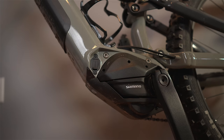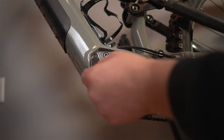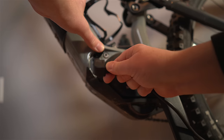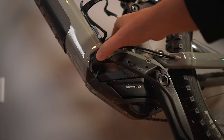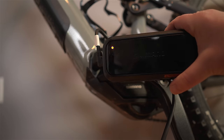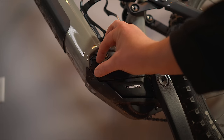For charging, you just plug the power brick into the wall and then plug the other end into the bike. There's a nice rubber port cover — always make sure that's on securely, especially if you're riding in the wet. The first time I plugged it in it took a lot of effort — I thought something was wrong, so just know you really do have to force it in, it's a really tight fit. The more you use it, it gets a little bit easier. That light will go out when it's fully charged, and it's also pretty hard to pull out when unplugging — just wiggle it and you'll get it.